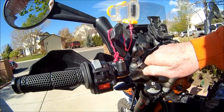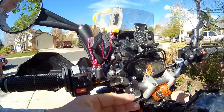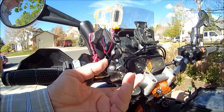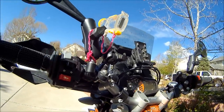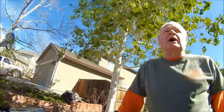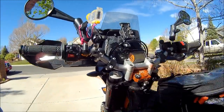Whatever the dial down under the seat is set at, that's what number two is. Number one is always standard mode. So your options for number two are either going to be soft — for rock picking where you don't want it to loop on you — wet pavement, bad gas, or the advanced mode. You could tune that depending on where you're going. If you're going down to Mexico you'd leave it as standard and have the bad gas setting available. How do you know if you're getting bad gas? I think it's low octane — like if it's supposed to have 90-something and you're only getting 87, then you flip it to the bad gas setting.